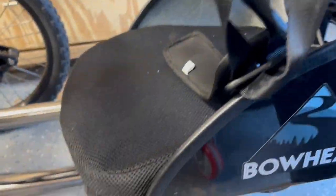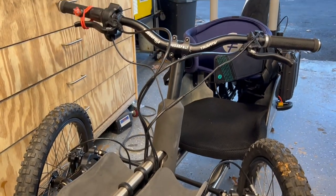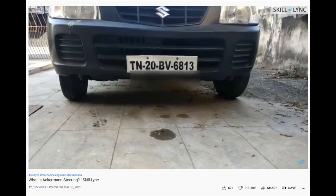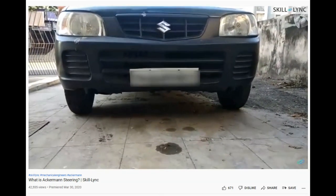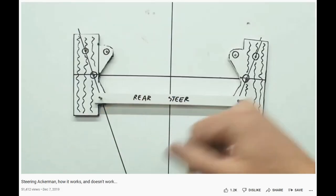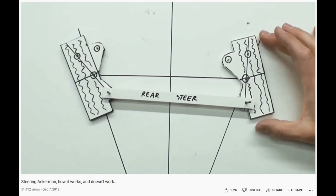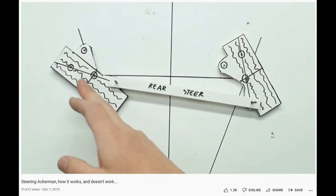The seat is also just a black painted piece of plywood instead of something a little more sophisticated and engineering-worthy of an $18,000 bike. Another place where the vehicle dynamics could be better is in the front steering. In steering geometry, we look for Ackerman — this is when the inside wheel of a vehicle turns tighter than the outside wheel, because they're tracing two different circles if you think about it. There are some other YouTube videos that explain it, but I think this makes the Bowhead not steer particularly well when you put in a lot of extreme steering angle, and it would be a fairly easy fix to actually make the steering follow Ackerman principles.